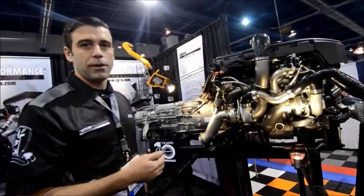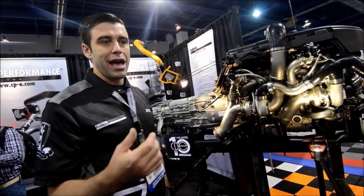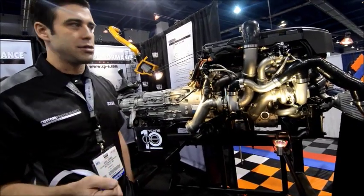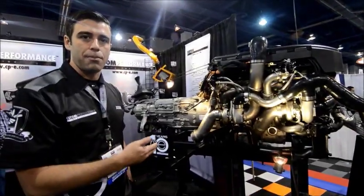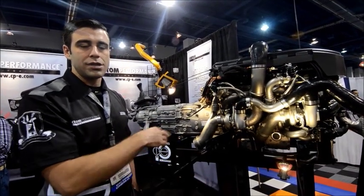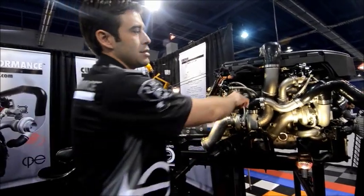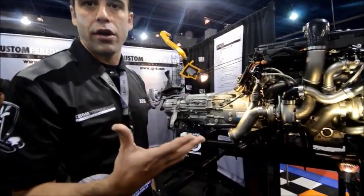These are the days of the new Supra and the new GT-R — this is a rebirth in the industry. Having that car that maybe your grandmother owns, and the next thing you know you get it, and it's got factory turbos with a clear upgrade path. No more smoky turbos. This is 100% bolt-on — no sending in factory parts to get reworked. It includes stainless steel, wire-meshed, silicone hoses, so no collapsing and no growing.